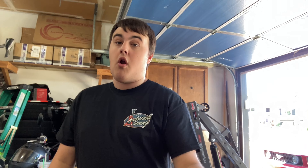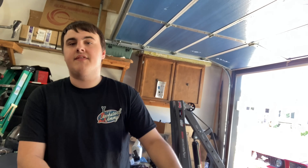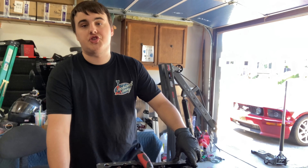We wanted to fix it for the last time. There's only a couple of interfaces where water and oil can meet - one is the rear, which has high pressure oil that could get into the coolant, that's where we suspected the issue was. Common places where coolant leaks into the motor are the lower intake manifold and possibly the front cover. All of those were fresh. The balance shaft thing was also one of the reasons it wasn't running for quite a while. So in December last year, I replaced the whole front cover - resealed it because we did the balancer shaft fix. The whole front cover was taken off and resealed with new gasket and RTV. That solved the balancing issue, but didn't solve the coolant contamination.